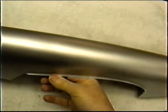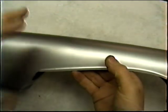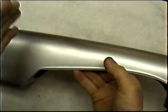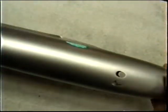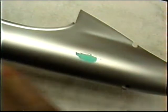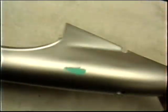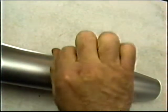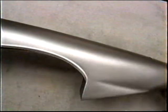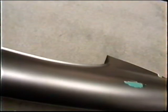I got the silver on all the parts, and what I try to do, and I do it in every step of silver, and this is the step that separates those last few planes and the last few rows. I look around and I try to find little spots, and I put some of my putty. Any place I'm not happy with, I see a little spot, and it could just be a pinhole spot. But now when I sand this out, this should be, let's hope, you know, we always hope, it'll be that last coat of clear, last coat of silver. I'm already thinking about the clear. You can tell I'm excited about this.